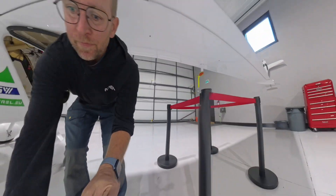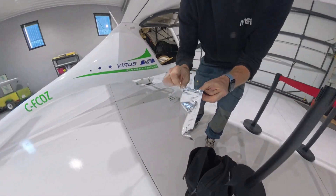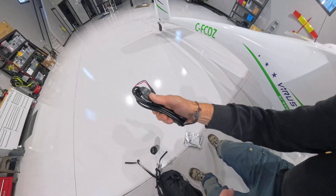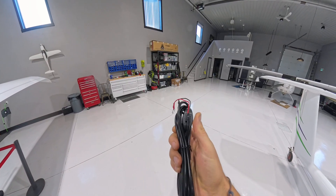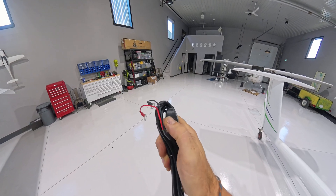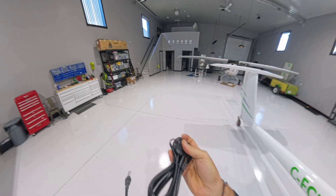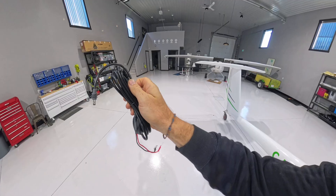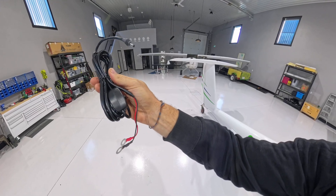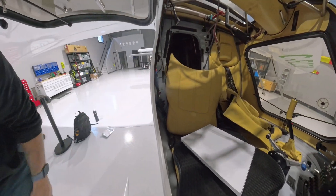I did actually buy a different cable that I'm gonna install — I got to modify it a little bit. This cable here is for the Starlink Mini, it's on Amazon — I'll put the link in the description. It has its own switch on it so I can control the power going to the Starlink Mini and shut it on and off when I need. The switch is close to the terminal connections right now, so I need to cut the cable and move the switch so it's closer to inside the cabin. That will be pretty nice. For now, I'm gonna test out the Starlink Mini today and see how it does at full cruise speed.